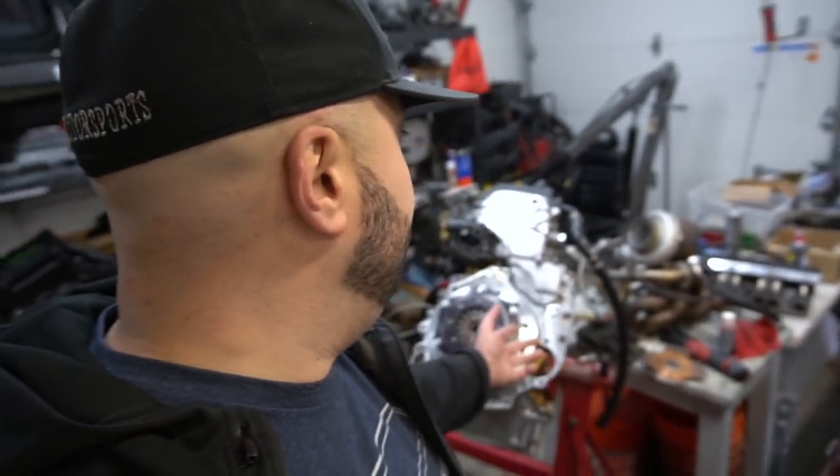So make sure if you're ordering the Tilton clutch, or if you're stripping them out and you know it's not an alignment issue, reach out to Tilton and let them know you need the hardened center splines on your clutch discs. A rep from Tilton about a year back said they were changing all their 01E Audi transmission clutch splines to all-hardened as standard, but there might be a few kits out there that haven't been updated. If you happen to get one, before you install it reach out to Tilton, give them your serial number, and they'll let you know whether or not they're hardened. If they're not, swap them out. We were barely making any power in version one of the silver car and we were still stripping them out.